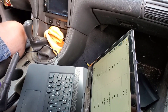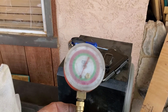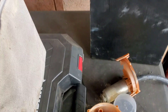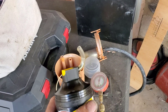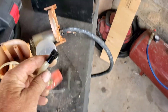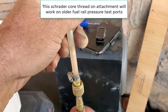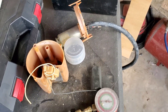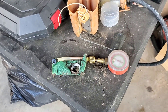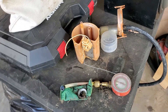So now it seems to be running at normal pressure again. For a ForScan to the rescue. Just to make sure the transducer was even reading correctly on the engine, I had this hooked up - this rig. Sacrificed one of his cans of fix-a-flat, because I know they have the thread-on style Schrader valve hoses. I cut the hose off that can of fix-a-flat. This was our mechanical pressure gauge - an old refrigerant gauge. And it matched what the computer is reporting at all times, so we were satisfied the transducer is reading correctly. The diagnosis is a fuel delivery problem.